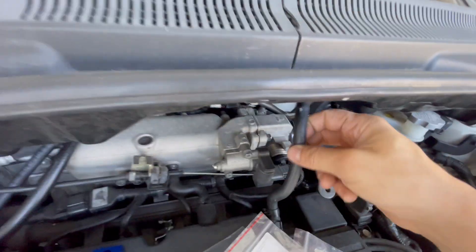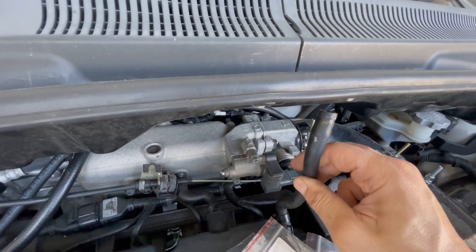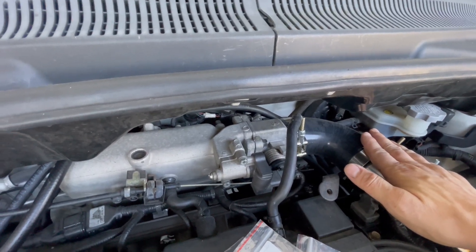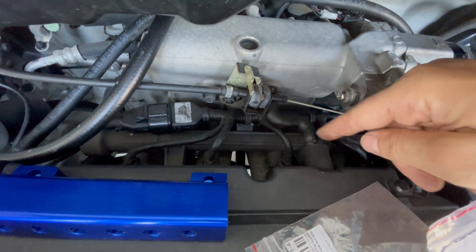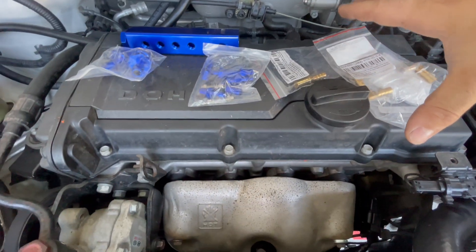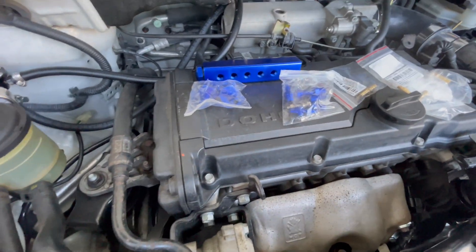This engine is not designed to see boost, but now we're going to make it see boost, so there are things that need to be fixed. The original intake setup can't be connected to a pressurized source — that includes this pipe and this little S-bend — because if they see boost, it's going to pressurize your rocker cover and all the oil in there, and that's going to pretty much send your dipstick to the afterlife. I've heard dipsticks can actually launch.